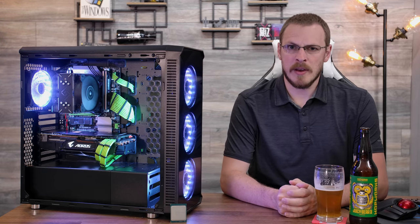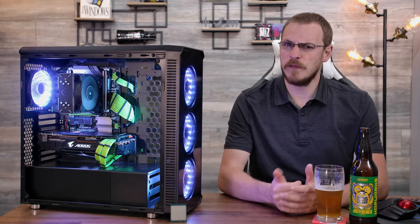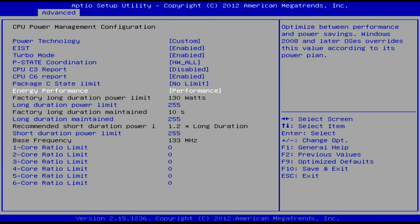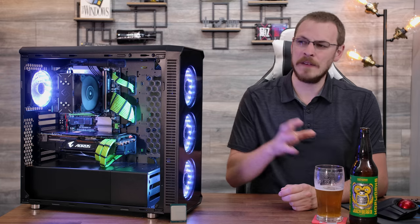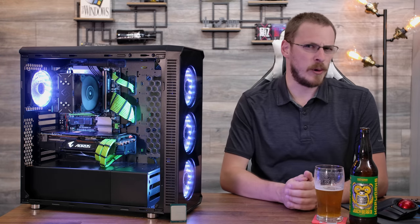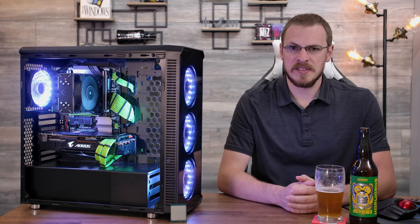The Plex HD X79 motherboard and Xeon E5 1650 6-core 12-threaded CPU — but how high was I able to overclock it? Unfortunately, 3.9 GHz seems to be a hard cap on this motherboard, and it's not through lack of trying. The multiplier values I entered didn't correlate to the proper reported speeds in Windows. For example, entering 37 yielded 3.5 GHz, 39 got me 3.6 GHz, and 42 finally got me 3.9 GHz. However, 45 and even 50 still got me 3.9 GHz — it's a hard cap in the software. At 3.9 GHz, the system is solid as a rock, and CPU temperatures never went above 58°C with the Gammaxx GT cooler.